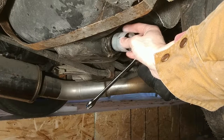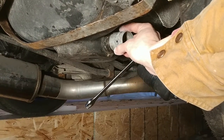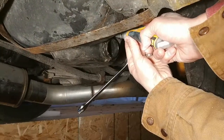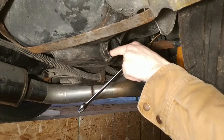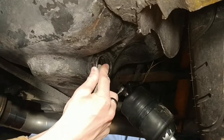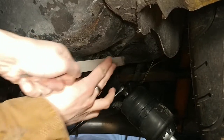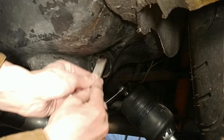Here I'm just test fitting the ring that's supposed to be in the tank and discovered I'm going to have to cut a bit of this lip off just to get this ring to fit back in. So we're going to have to trim it up, file it down, and then we'll have the room we need to get this ring back in. Any plastic you cut out, you want to really make sure you don't leave it in the tank. Now when you're doing this you want to make sure that the surface is nice and flat. I got a little bit carried away here and now I don't have a flat surface, so I've created a point where I'd be highly likely to leak even with the gasket. So I'm going to file it down and get it so it's a nice flat surface.